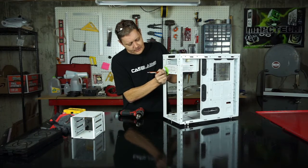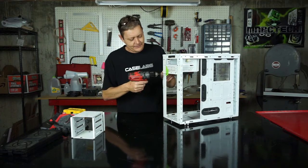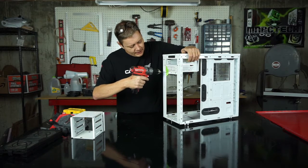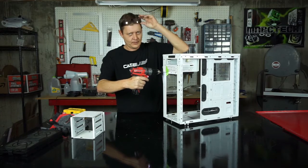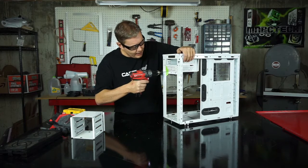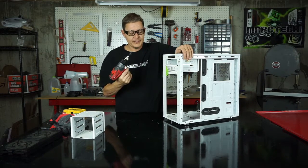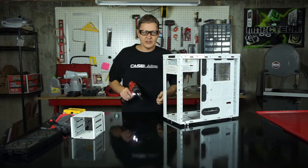and you can see where the rivet's at, obviously. What that does is, if you happen to miss a little bit when you're putting your drill up there, it just keeps you from scratching things up. So that's our first rivet, we're going to go ahead and drill that out. And wow, see? It doesn't take much, you don't have to go real fast. It's aluminum, so it drills pretty easily. One rivet down. Now I'm not going to worry about taping the rest of the rivets because I don't care if I scratch paint.